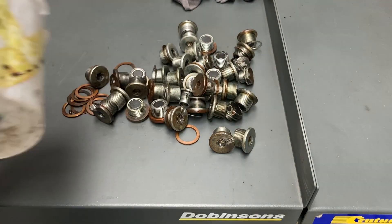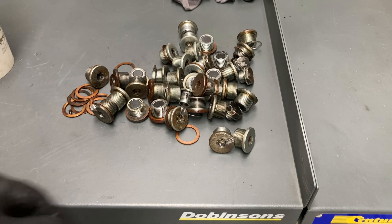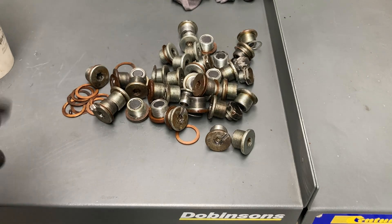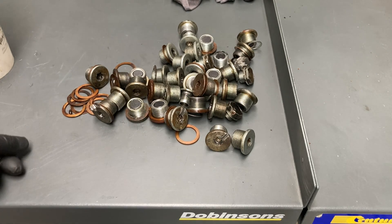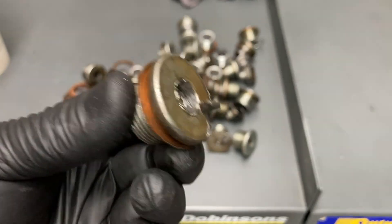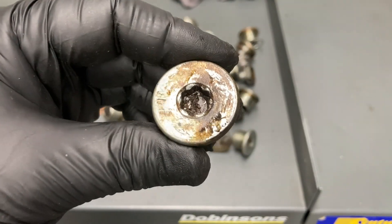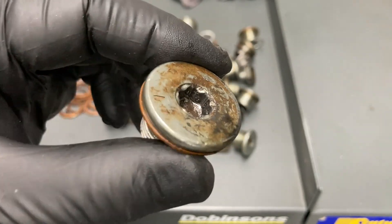My diff plug container has been full for a long time. In case you missed it, I think we've got a playlist on diffs and lockers that probably includes stuff like this. I'll just quickly tell you the problems and the solutions — the solution of course is kaon.com.au. What happens with these is people over-tighten them, and it's as simple as that. There's nothing wrong with this design whatsoever — it's not soft, it's not this, it's not that. It's people over-tightening them, and this is what ends up happening. How do you get it out? The special tool from k-on, or you can get it out with a chisel. Do you think I'm going to put that back in a vehicle? No way.